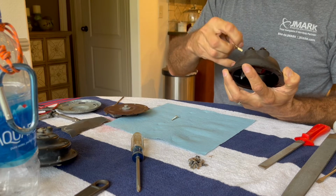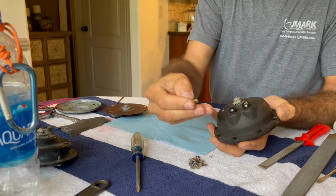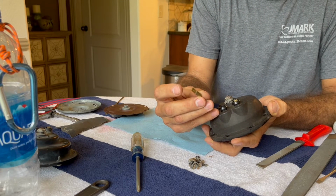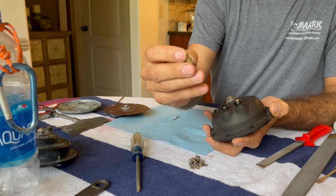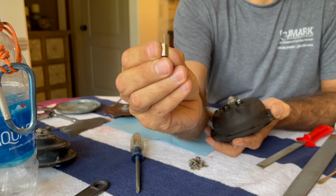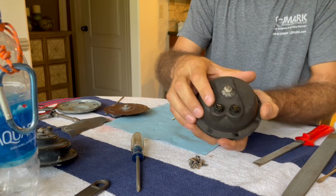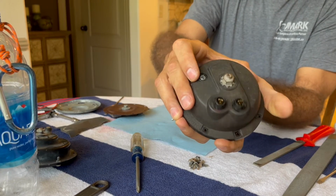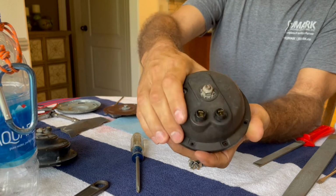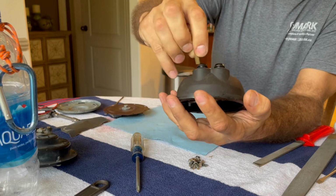And let's see here. Kind of seems like the orientation of these lugs is maybe important. Yeah, kind of. That spade is offset just slightly from center, so I'm making sure that the offset is in that direction, which keeps it in the center of the hole, as opposed to flipping it around this way, which puts it very much off center. So flip it back around.